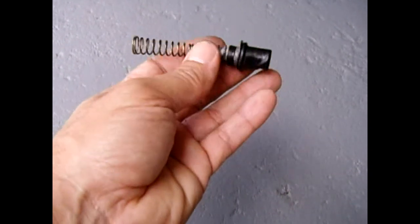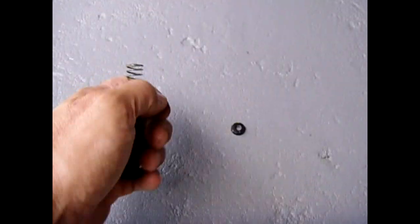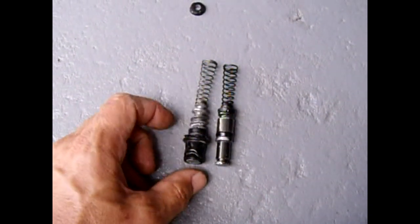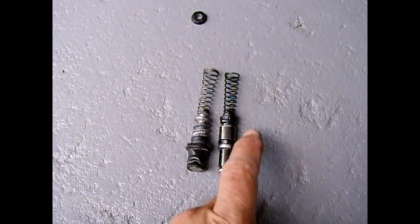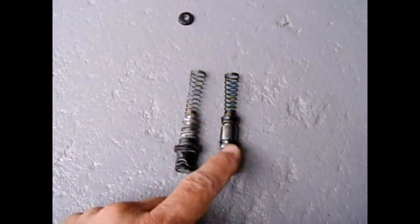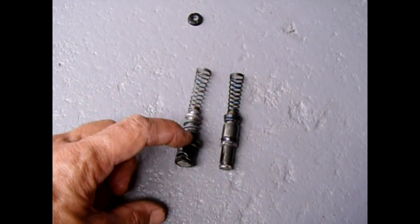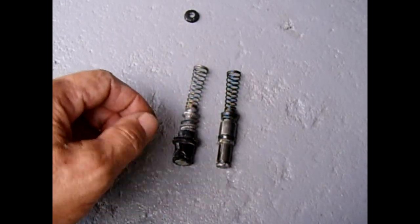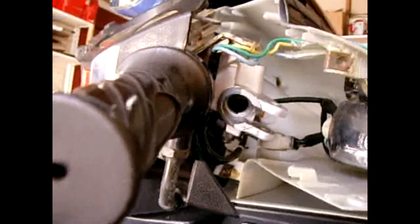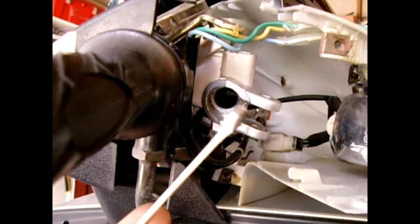What I'm going to do now is try this one out — it's from the exact same reservoir but a different manufacturer that I had laying around. The gaskets are in great shape. The two pistons are pretty much identical in length and the positioning of the gaskets. This one is about four years old and still looks pretty good, so I don't know why it's hanging up, but it is. So I'm going to try this one out and see if it makes a difference. I'm going to take the same gasket, install it there, put a thin film of silicone grease over it — a thin film on this side too. Then I'm going to take some brake fluid with a Q-tip and go into the opening on the cylinder to make sure there's no gook and grime. As you can see it's not nice in there, so I'm going to clean it out thoroughly.